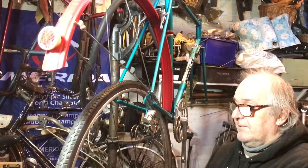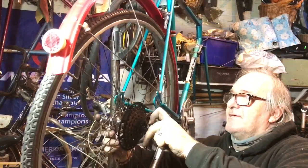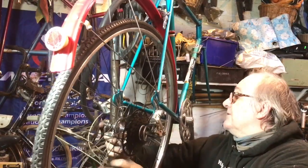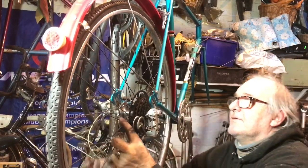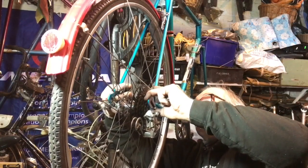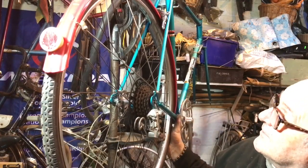Most of all you need to be able to slot the wheel in and out comfortably without bending the frame or putting any tension on it. When you've got a stack of secondhand wheels you're using in bikes you're building up, you've got to adapt each wheel to each bike carefully. These are the wheels that came out of this bike so I'd expect them to be already close. I do like fitting wheels with the bike upside down — it's so much easier.